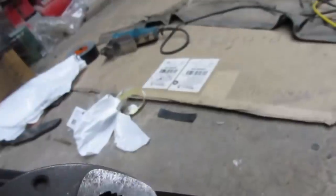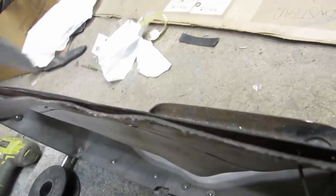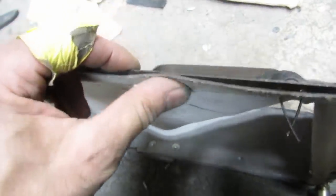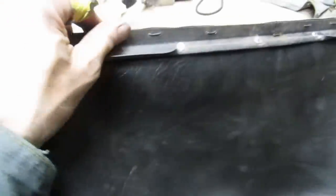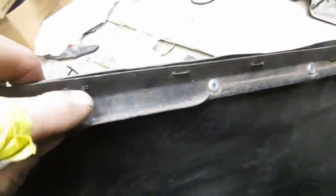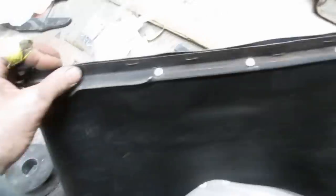Just go back to the other pliers. And one from the other wing. Now obviously it's mild steel, it's very soft, but it does work hard enough when you crimp it over that it's a pretty passable staple, and sometimes just saving the trip to the store is the most important part. This is actually very handy on American cars of the post-war. They all have this type of arrangement holding the mud flaps around the top of the control arm, and it's very often missing, but this is an easy way to recreate those and just use the original holes. Staple them back in, looks good, and looks a lot more authentic than pop rivets, and then you don't have those weird holes in your fender well or wherever.